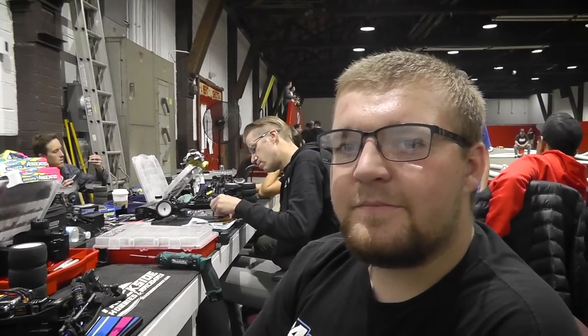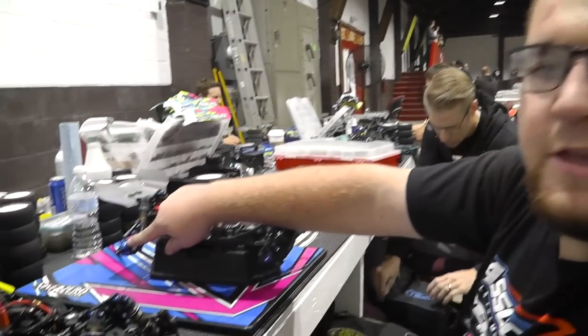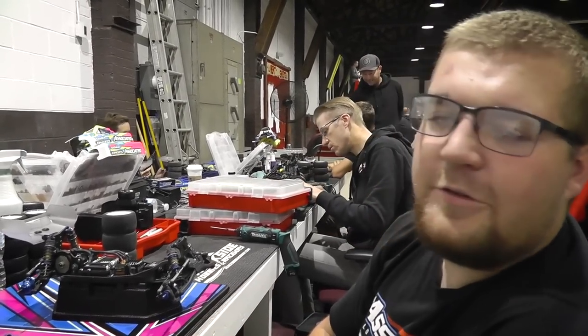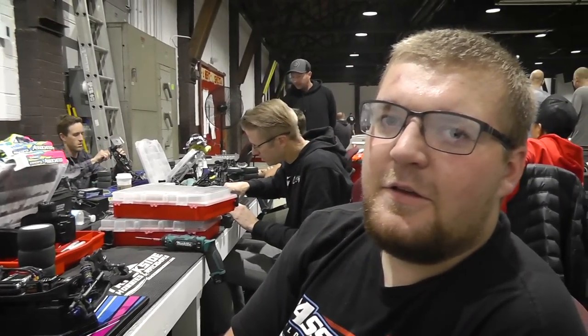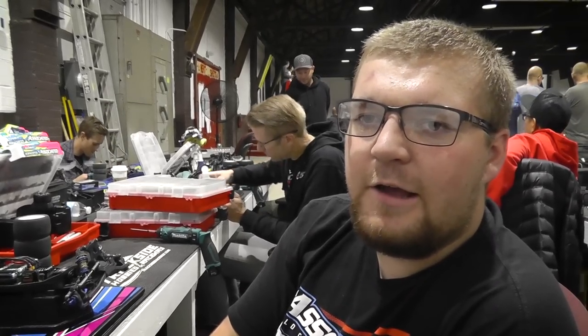Anything that you've been doing different here versus racing at home? You've made any big changes or small changes? The one big change, BT told me about it, is that we ran a longer link on the rear hub. I'm not all the way long like he is, but I'm running almost all the way long. That was one thing that we did at Motorama as well, just because it was a little bit lower grip and a little bit more off-camber stuff. I just really settled the car down.